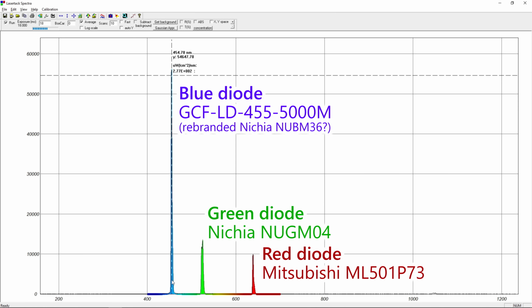Show lasers are meant to be seen, but make sure that no one ever will be able to look directly into the beam or specular reflections of it. And wear laser safety glasses when experimenting with any laser.